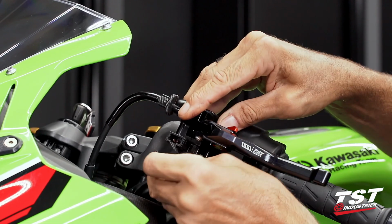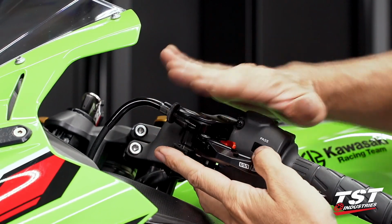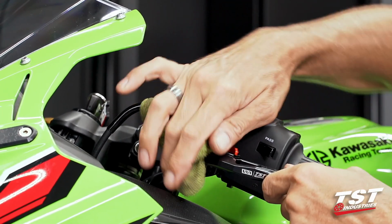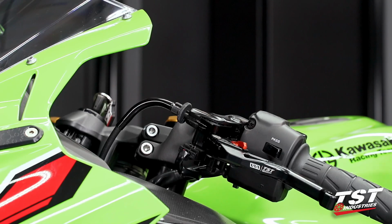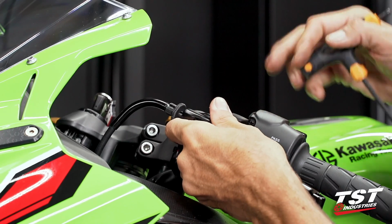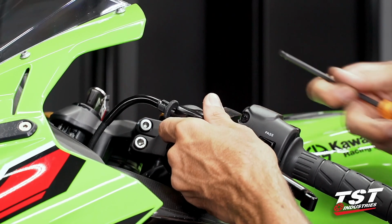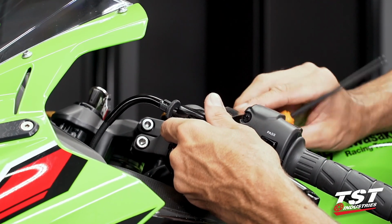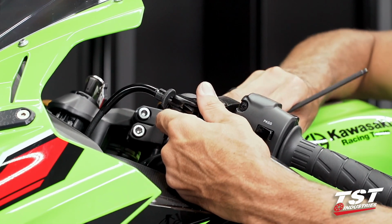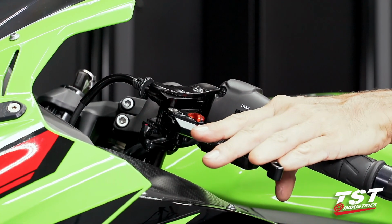Go ahead and connect the reed switch connector back in. That requires that the perch gets rotated back towards its home location. Now, let's go ahead and adjust this setup back to where it was. I did have a mark here between the bar and my perch where the perch splits into two pieces. You can help yourself along before you start by putting a mark there, or you can adjust it at this point.